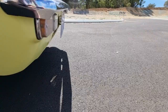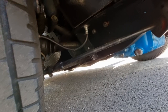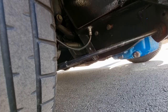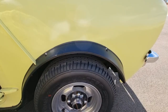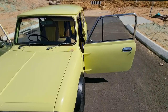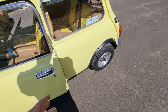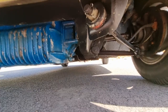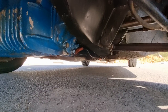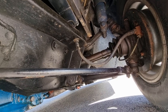You also want to check your tie rod ends, your bushes, everything under there. Have a good look around and check for any rust. Your suspension towers — the Mini suspension runs a rubber cone. This has got high-lows so you can adjust the height. They did have hydroelastic on some years, but that became troublesome and they ended up swapping back out to the cone suspension. Don't worry too much about oil leaks — you will get them, the tolerances aren't great on the motors. But you don't obviously want anything excessive. They're quite harsh on your wheel bearings and ball joints, so if you've got the time just lift her up and give all that a wiggle.